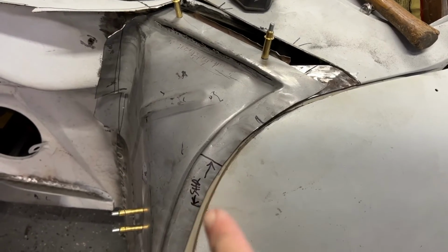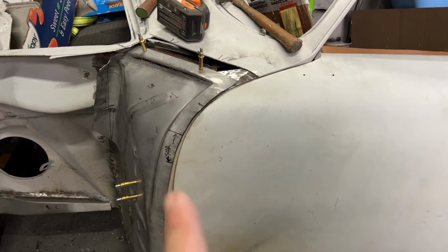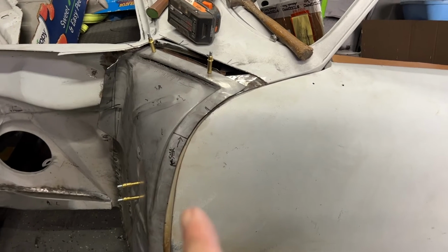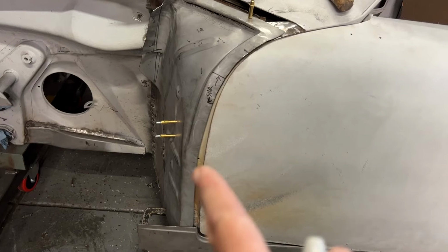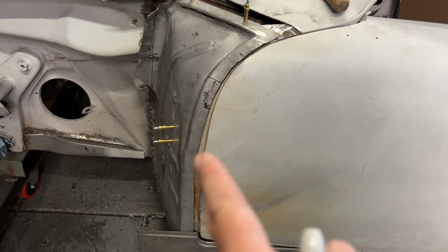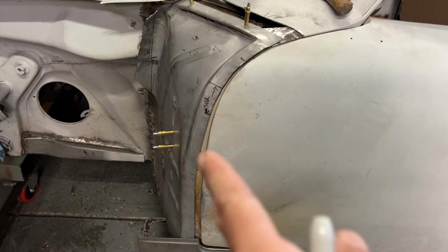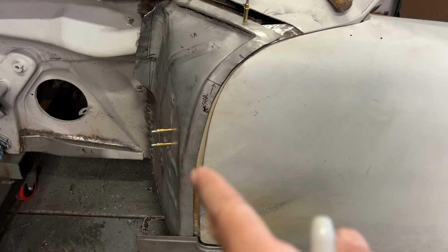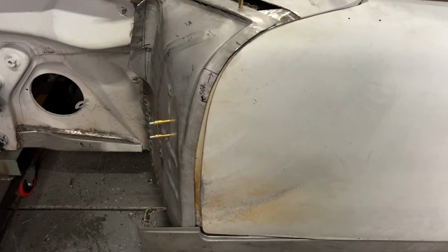I made a little note to shrink there. Let's just think about this. If I shrink that, it's gonna basically make that a hinge and everything comes in. So the bottom will be real tight, but then this here will be loose. So I think we need to stretch some of this in here so that it flattens back out. Does that make sense to everybody?